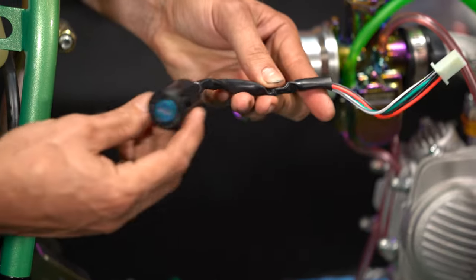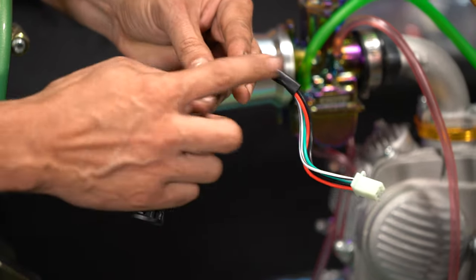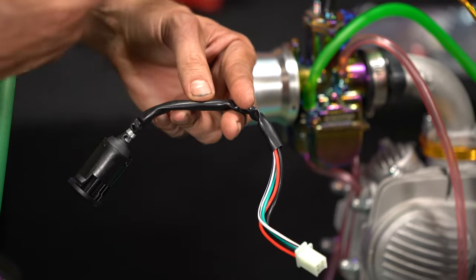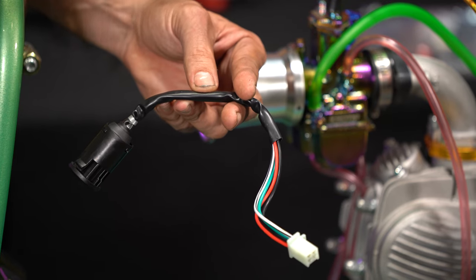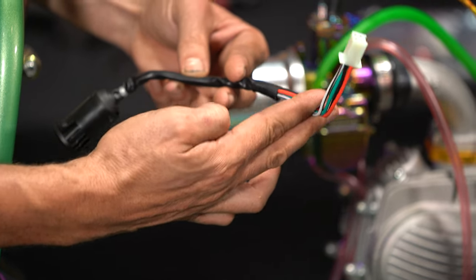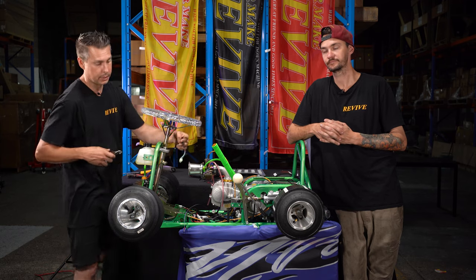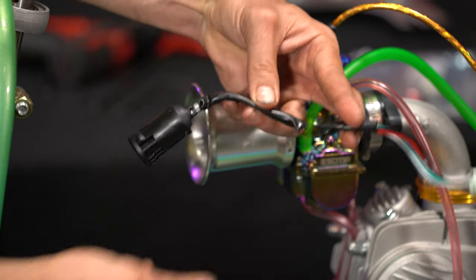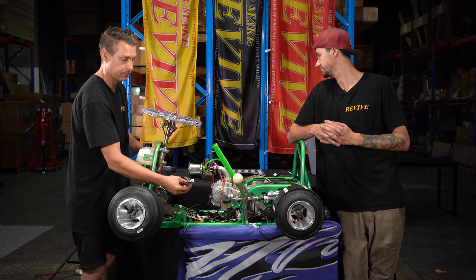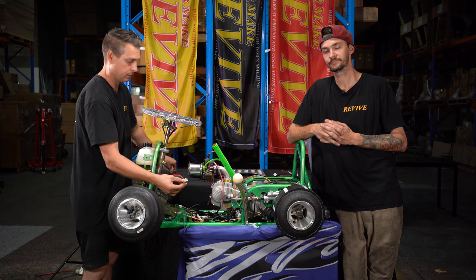The ignition barrel is obviously going to have to be fitted up here in the dash panel. This loom that comes off the back of the ignition barrel, we actually want to cut this in half. Half of this loom is going to stay down here with the engine wiring, and the other half is going to fit to the dash panel, and obviously we're going to fill in between those two. So I'm going to grab my cutters and we're going to cut this loom in half. Cut my loom, we can sit our ignition barrel off to the side, remove the shrink off our loom,